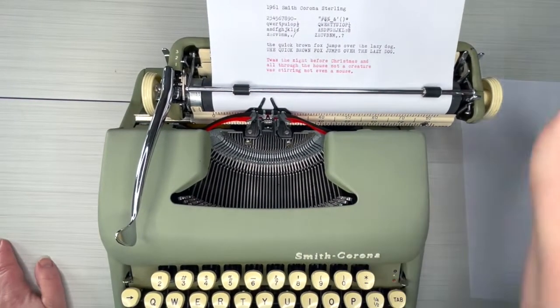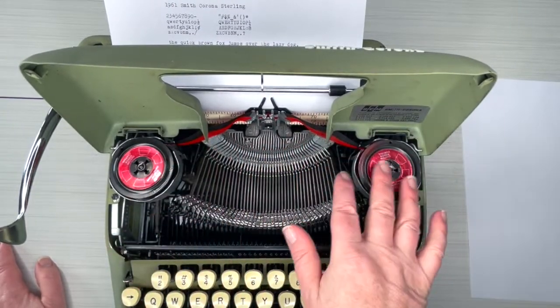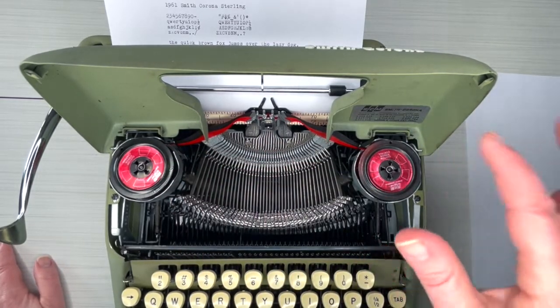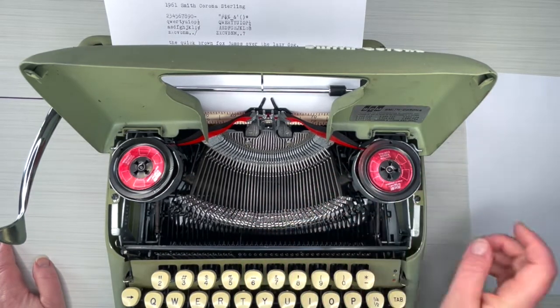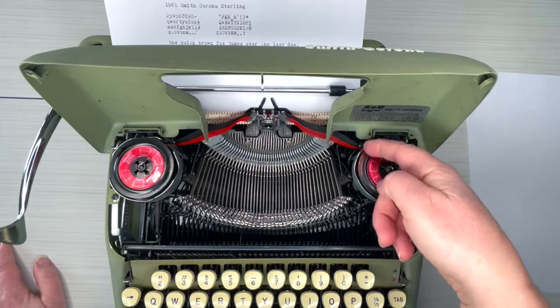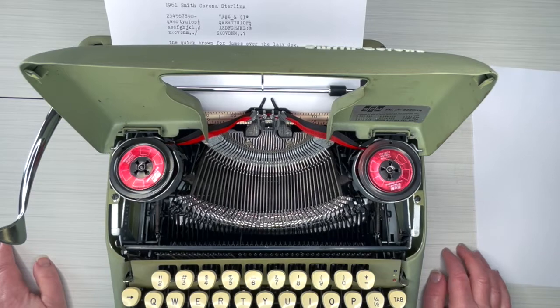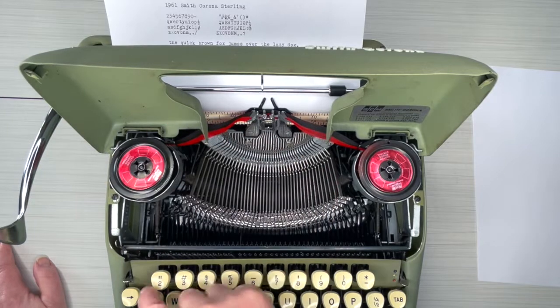Very nice. Also, I forgot to mention, so when it's time to change out your ribbon, and maybe you don't have this particular machine I have in front of me, but you have one like this and you want to know how to do your ribbons, please go to the product listing in the description. There's going to be a photo so you can see how to thread your ribbon. These just pop in and out, very simple, but you just got to make sure it's threaded through these guide wires. And so bookmark that image, make sure black is on top, red is on bottom. And if you're still having trouble with ribbon, try reversing the direction and see if that fixes it.